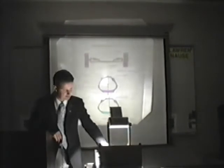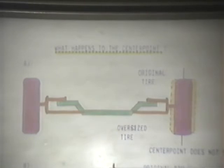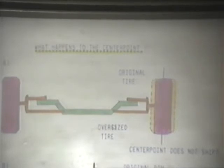Take a look at the rim problem again. We mentioned that earlier, that came up in discussion. If you change the tire on a rim to a slightly different width of tire, it's really not going to affect the center-to-center track width, because the tire will be displaced an equal amount on either side of the rim. Even if you put a slightly bigger tire on a vehicle, or a lower profile tire that's a little bit wider, it really won't affect the track width.